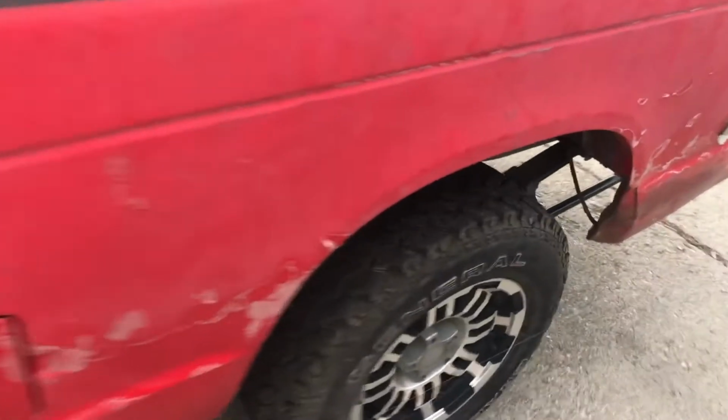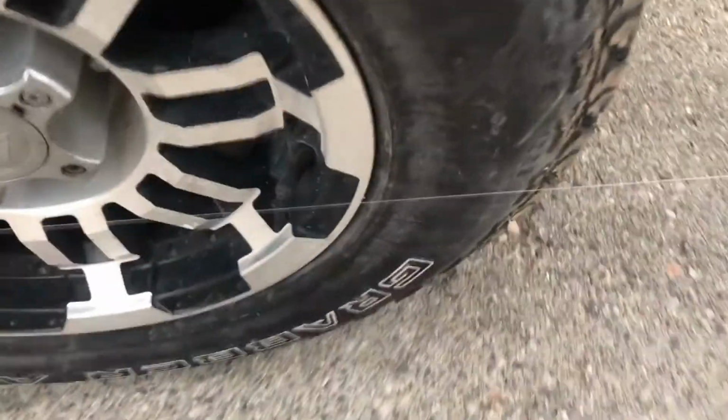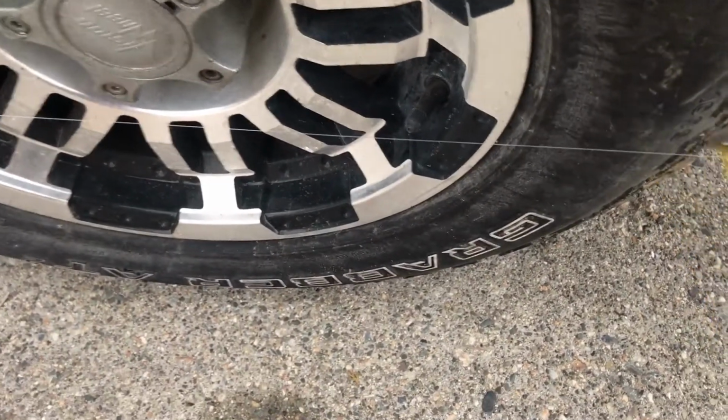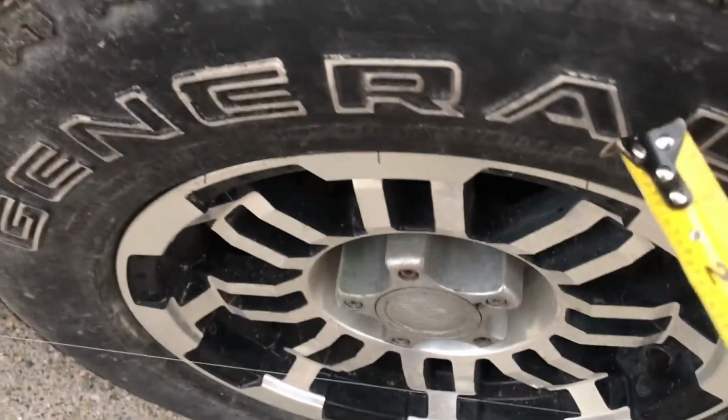Then, assuming that my back axle is in alignment, I pull the string tight, and then I carefully and painstakingly set it back and forth, moving the buckets forward and backward just a little bit, to line it up on the smoothest part of my tire here. I had to rotate it so that my white wall lettering was not in the way.